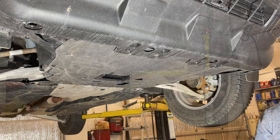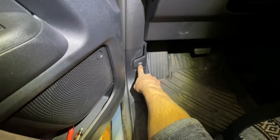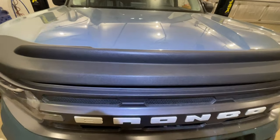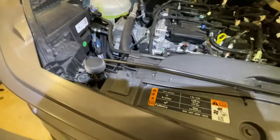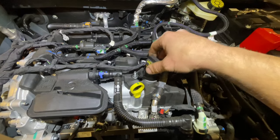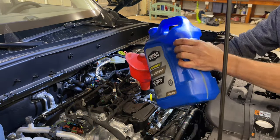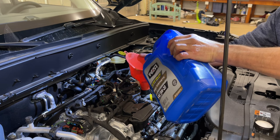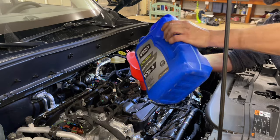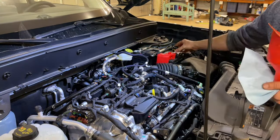Now we're ready to drop this thing back to the ground. Now that we've got it back down, we're going to open the driver's door and release the hood — two times for hood release. It doesn't have the traditional hood release, so two times in there, then we can open it up and put the prop rod up against the hood. You can see on the oil cap it says SAE 5W20, so that's the oil we're going to be using. We've got our funnel in here and we're going to dump the entire five-quart jug in, then dump an additional 0.3 quarts in. Now we'll take the funnel out and put the oil cap back on.